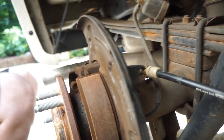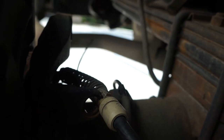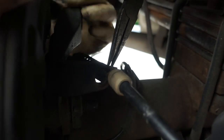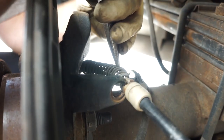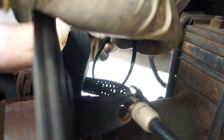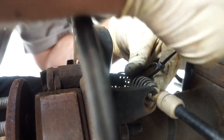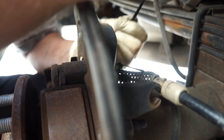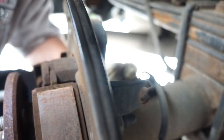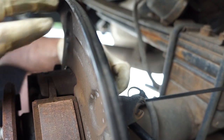If you can't get it, the easiest trick is to use a zip tie. Get the zip tie through the majority of it, and then with needle nose pliers, pull it through. You'll zip tie it so that it holds this return spring — just keep zip tying it. As you can see, the spring is now compressed and you can much more easily remove this component.